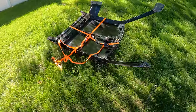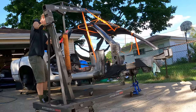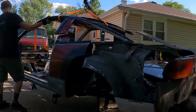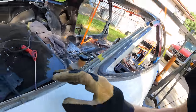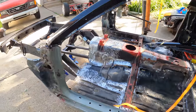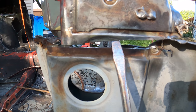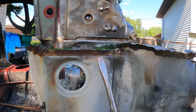Let's test fit the roof. The roof is fully on the car and the weight is off the hoist — so exciting! It's not exactly lined up right now but I can see where it needs to be trimmed. This part needs to be trimmed a little bit. Since this is the same car, this seam on the A-pillar is the same as this seam here, so I need to trim one back a little and straighten the other out. Then I'll know the exact location because they'll be bump to bump.